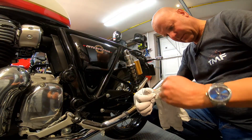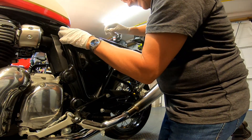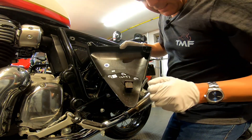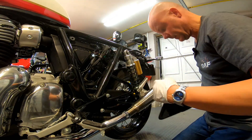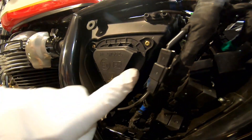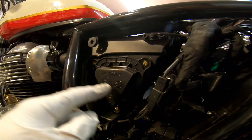Okay, the screw's out. I'm just going to stick some gloves on so I don't get covered in any gunk. This panel has to come off — it pulls away out that way and then up apparently. It's out that way easy enough. Just to show you what that's like — there's the up bit you pull out and there's the little lug, and that's where the screw was. Right, and here we can see the air filter assembly, and this is the inlet that lets the air in. You can see that is the size of the air inlet. So what I'm going to do is take this off and replace this whole bit with basically an open bracket, and the filter is underneath there.